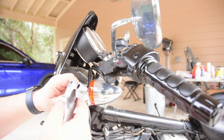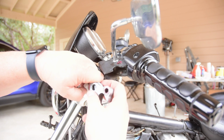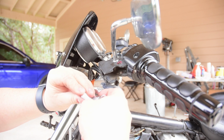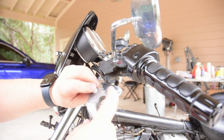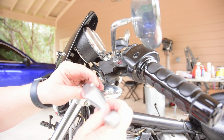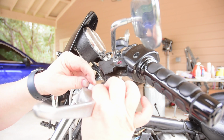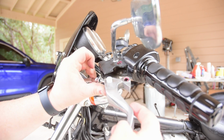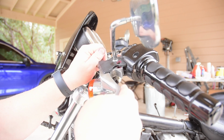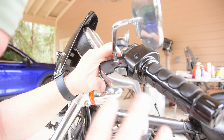So we are going to drop the O-ring into there, put in the nylon bushing. I've already put that brass thing in there. It's being held in with just a little bit of grease. Oops. Nylon bushing goes the other way. It's got a little lip on the top. There we go. The nylon's only going to fit this way because there's a lip right here. So we push it forward and we go ahead and seat the clutch. Make sure the brass doesn't fall out.